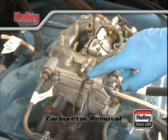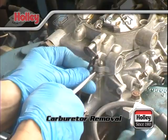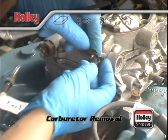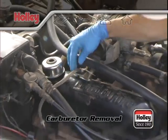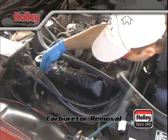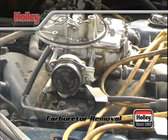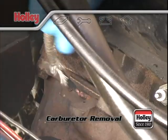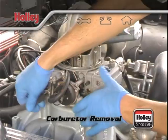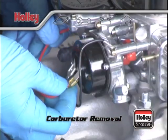When it comes to the choke unit, you'll either find a divorce choke with a lever that goes into the intake manifold — in that case, just disconnect the connecting rod from the choke plate assembly. You might have a hot air choke that will have one or more metal tubes that bring heated air or exhaust into the choke unit. The tubes will either thread out or will be pressed into a manifold and you can just pull them out. If your engine has an electric choke, it should be as easy as labeling and disconnecting a wire or two.